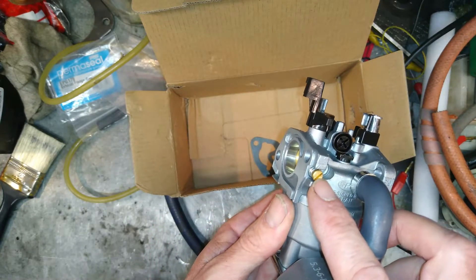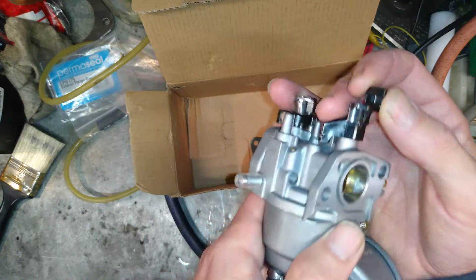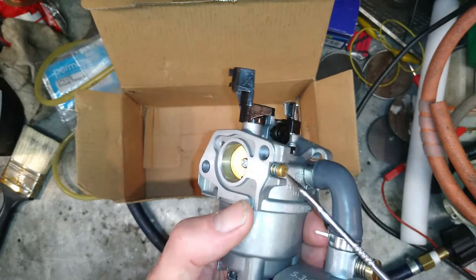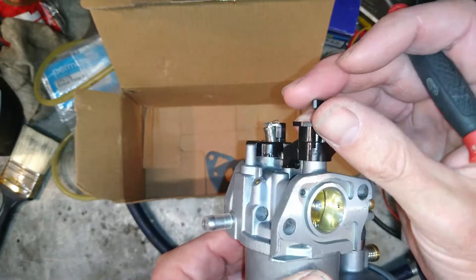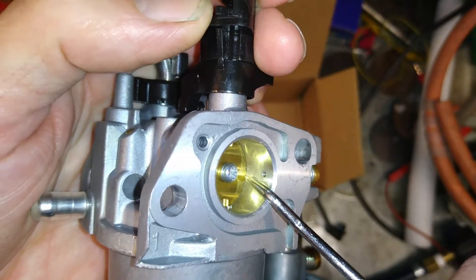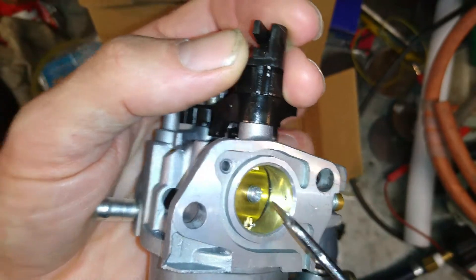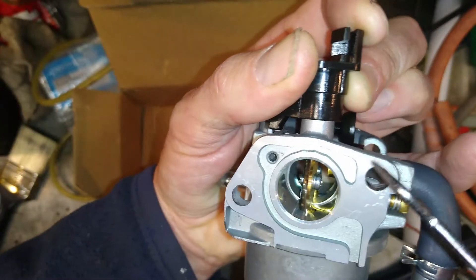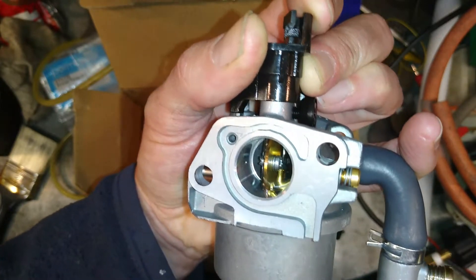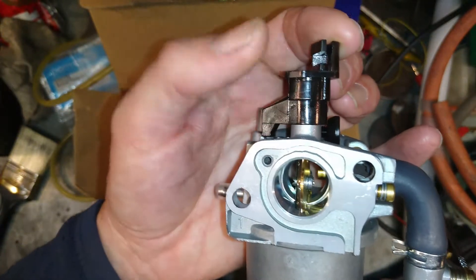There's a mixture screw here for idle, and once you get up through the revs the throttle opens up and you'll use some secondary jets. This sets the idle — the idle jet is this little hole here, behind the throttle plate. Down in here you'll see some secondary jets — as we open it up there are a few along the wall, just some tiny little holes. Those are the transition jets from idle to full throttle. As we open it up further, that little brass stem sticking up comes from the float bowl and that is the main emulsion or power jet that you use for running at full throttle.